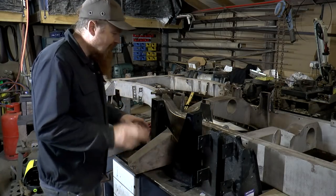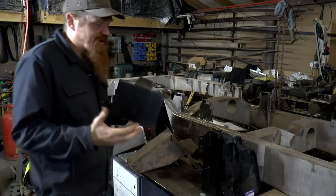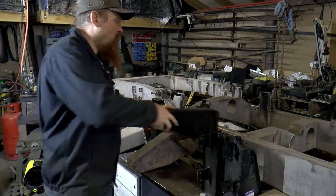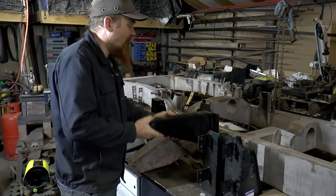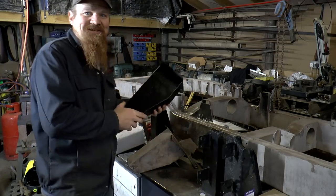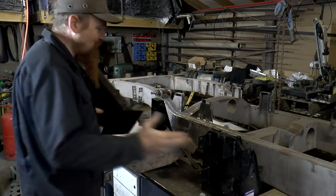So I've dragged them all out. Now these outriggers, they're pattern replacement parts so they have this great big backplate so that when you weld it on, presumably you can go from the dodgy metal onto some good stuff. But it's all good stuff on this chassis so I won't be needing these backplates. I'm going to cut these off of all of them.